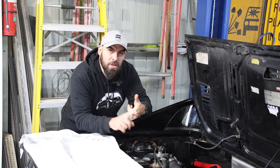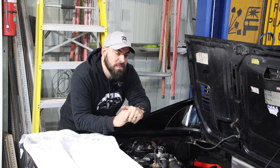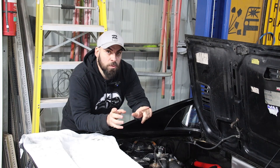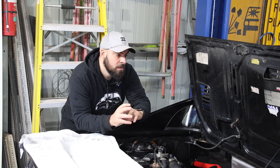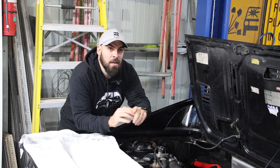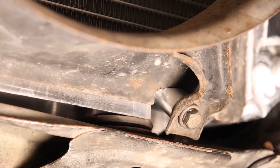With the cooling system work done: we drained the fluid, flushed it out, the thermostat housing has been cleaned up and re-gooped. Brand new thermostat and gasket in there because the old thermostat was actually rusted open. The replacement aluminium radiator has been installed — we reused the coolant temperature sensor off the old one because the new one we'd bought had the wrong plug. The OEM thermo fans were kept because they have a shroud and obviously work — all we had to do was clearance around the radiator's mounting bosses for the fans to attach.